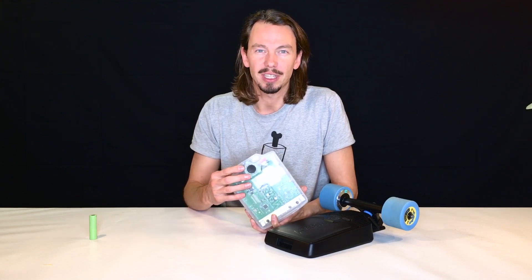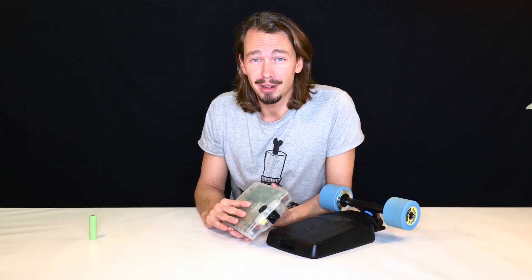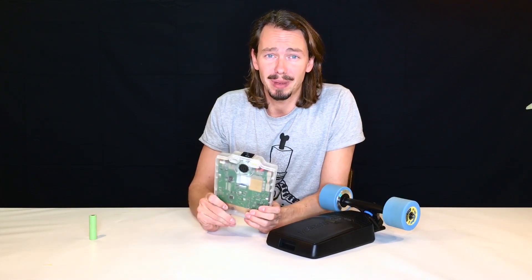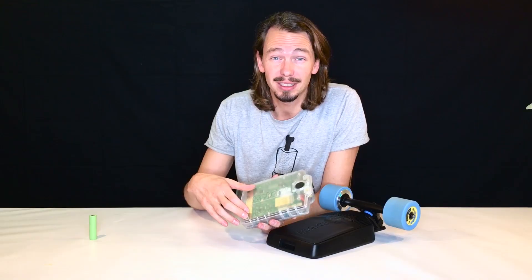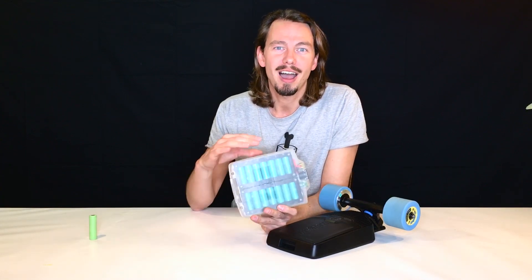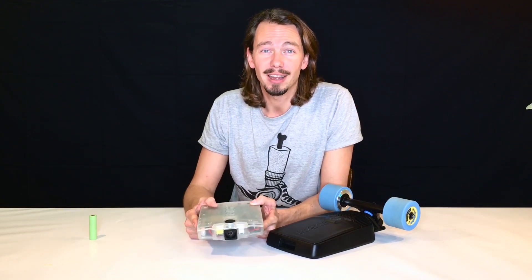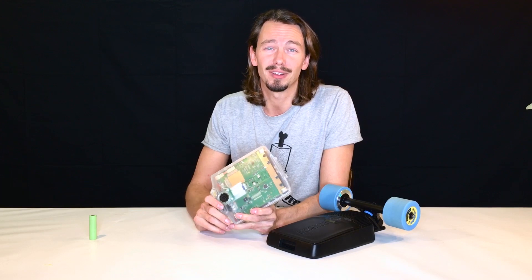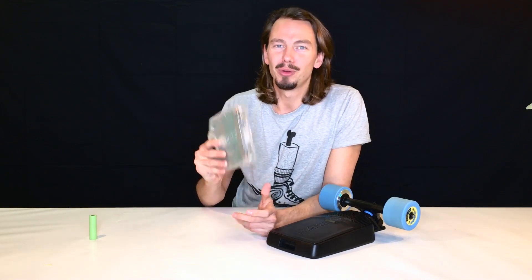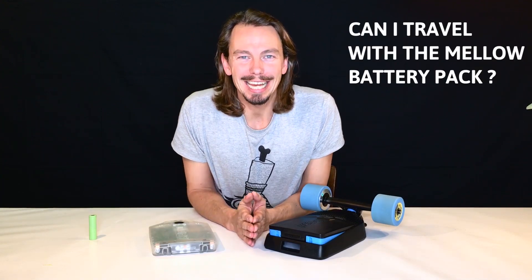Question number seven: what about fire? Electric vehicles like hoverboards have been known to go up in flames — something you don't want to happen with your Christmas present. We set a lot of focus on the safety of this pack. On the inside you have a BMS with a dedicated safety chip monitoring everything. We use Samsung cells, which are amongst the highest quality cells in the world. And if anything goes wrong, the battery housing has the highest fire retardancy level you can get — UL94 5VA — meaning not even a burning gas flame can burn a hole into this housing under the conditions of that test.